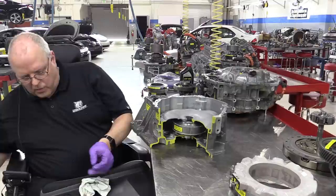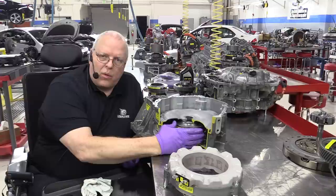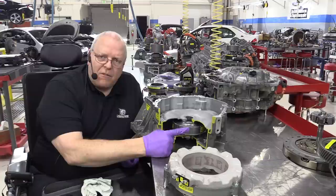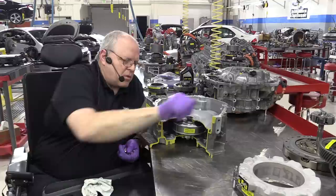This big gap that's in here, of course, is where the MG1 stator would sit, but I can't put that stator in there. Even if I cut it away, I can't put the stator in there because the magnetic field strength is so strong that I cannot rotate the MG1 rotor as I need to during my demonstration. So I leave the MG1 stator out.